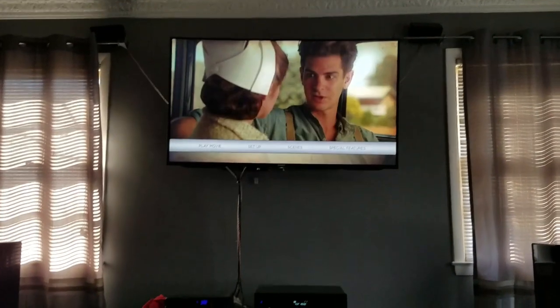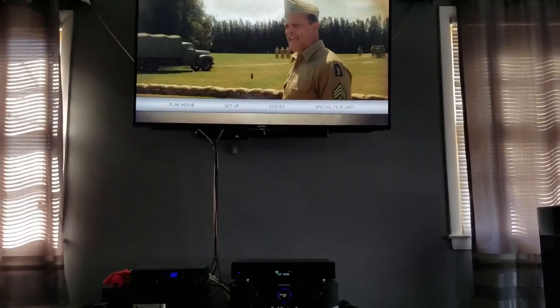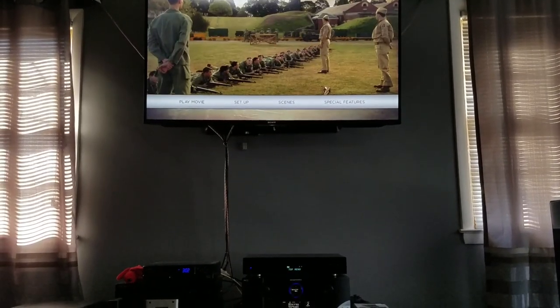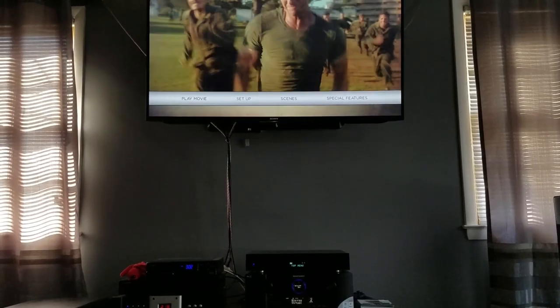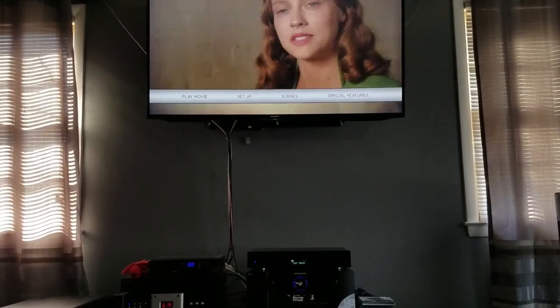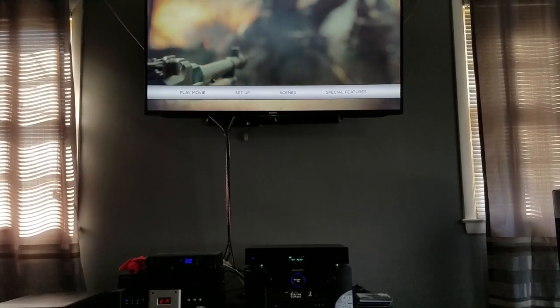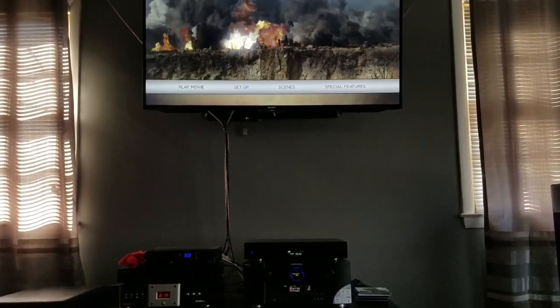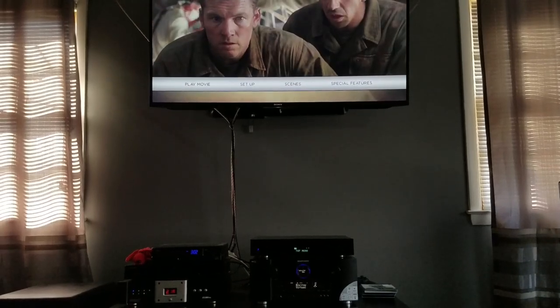You're not going to need to virtualize any further channels with Bitstream Direct. Linear PCM is best if you're watching an older DVD, which would not have surround sound beyond Dolby Digital 5.1. We're in the age where Dolby Digital is kind of old. Dolby True HD is still showing up on most receivers, but Atmos is what we're looking for — and it's not happening for a lot of people because you need the decoding features. Those devices require that Dolby Atmos or DTS-X sign as a decoding feature.